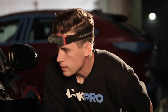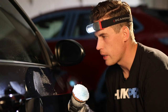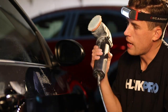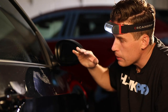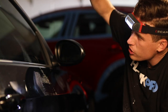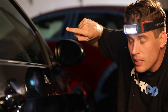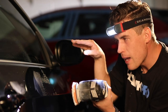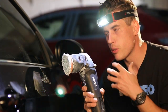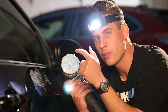So the pad is primed with M105 — it's kind of a moist pad with a little bit of moisture on the surface. This is where I wet sanded in an even pattern over a scratch. I've got it slightly moist with my detail spray — just an ounce of wipeout in with 32 ounces of distilled water. What you've done with sandpaper is created a very jagged scratch pattern because you're leveling the clear coat. You have a giant scratch, and you're trying to level the clear coat so that scratch is a little bit less giant. By doing that, you've created your own aggressive scratch pattern that you've leveled — so we're trying to make each scratch pattern a little bit less aggressive as we finesse it out. This is step number two: an aggressive pattern to get rid of our more aggressive pattern. I'm going to show you how to remove wet sanding marks with a compound and a microfiber pad.